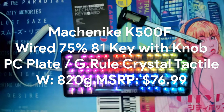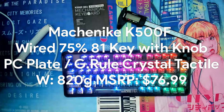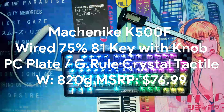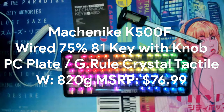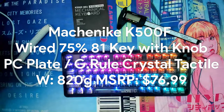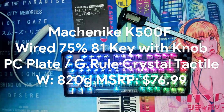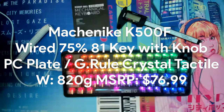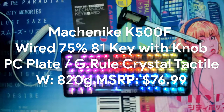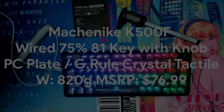The weight of this keyboard is 820 grams. The chin sits at 19 millimeters, while the base sits at 25 millimeters above the typing surface, giving you a default typing angle of 5 degrees. Raising the first included set of flip-out feet will take the back height to 32 millimeters, changing the angle of typing to 8 degrees. Using the final set of flip-out feet will raise the back up to 40 millimeters, changing your angle of typing to 11 degrees.